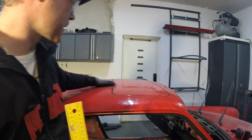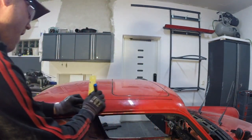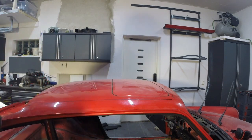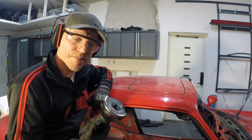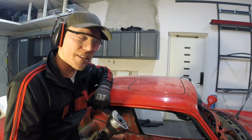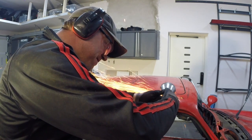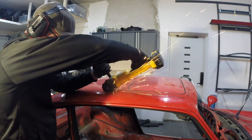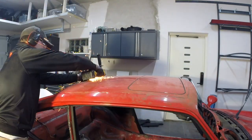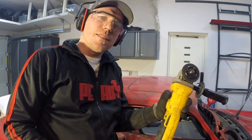I only need about this much for the new roof to adhere to this. Since this section is just to remove the roof, I'm going to leave a little bit more and do a coarse cut now, cutting closer to the actual sunroof opening. Once I have it out, it's easy to trim because I can stand in the middle of the car and be more precise. And very importantly — this is the piece that is going out. This feels very wrong, but it's too late to turn back now since I've already cut everything on the inside. This roof really eats discs — it's amazing how hard it is.